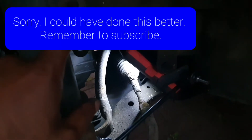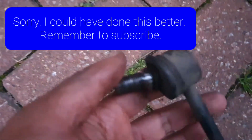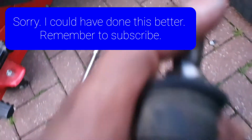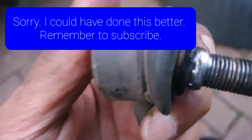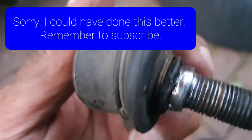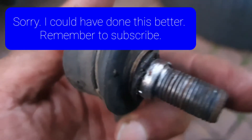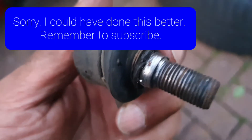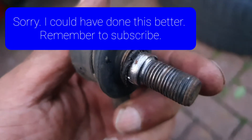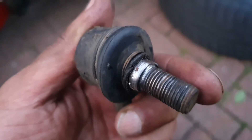It's connected by a 19mm socket here, and sometimes you have a nut at the back — you can just see it there. You have to get a 15mm spanner on that and then remove the nut using a 19mm socket. Hold that bit there, otherwise the nut will just rotate round, and that allows the nut to be removed.